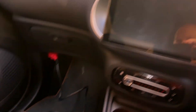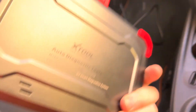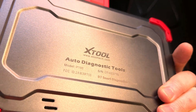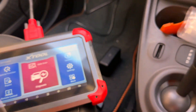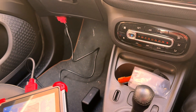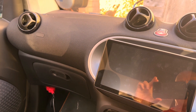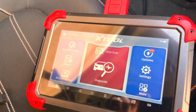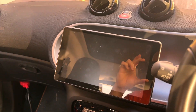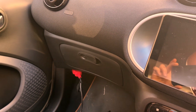So we need to break out the X-Tool — it says P700 but it's a D7 — to try and code new keys. What you want to do before doing anything is make sure the battery is okay. Because if that dies, or the battery for the car dies while it's doing it, you're in deep trouble.